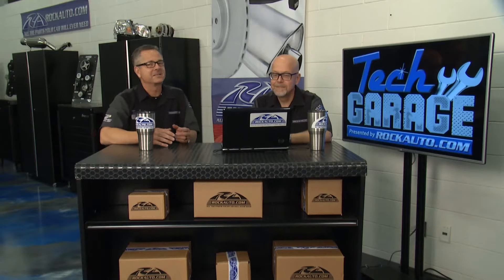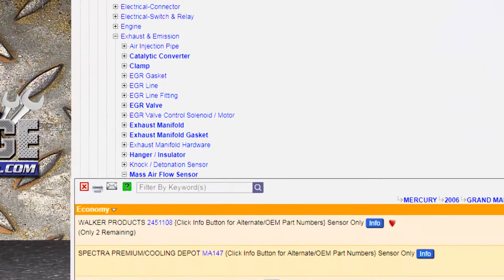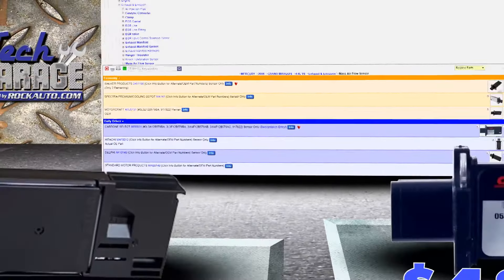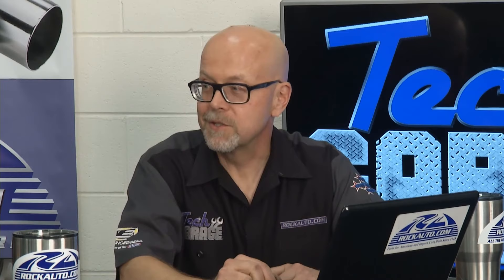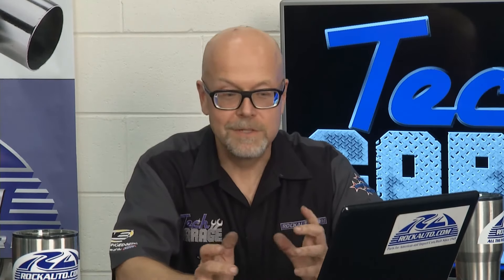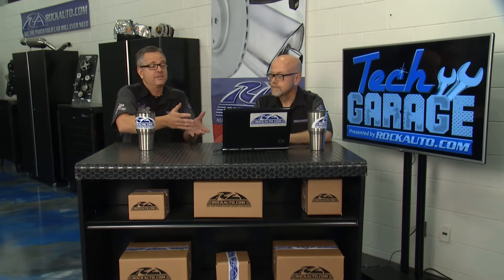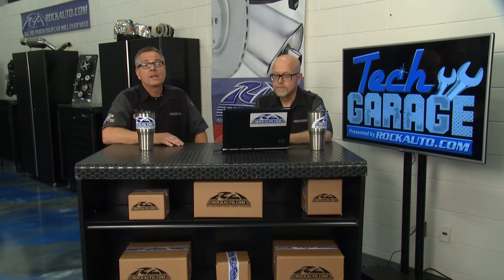What about the mass airflow sensor? There's a lot of problems on that car - especially in Florida with love bugs flying in, hitting a heated element, causing false readings. We're cleaning them continuously and they cause big problems on these cars when it comes to running. Mass airflow sensor - sure enough, bold print. Bingo. We have lots of manufacturers. Motorcraft and Cardone are hearted - a lot of people are buying that particular part number. Definitely another way to get clues about how to diagnose your vehicle based on what other people are buying for it. This is a good way to diagnose - if your diagnostic leads you in that direction, it's probably what's wrong with your car.